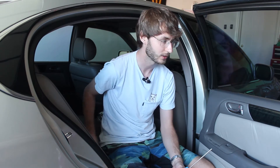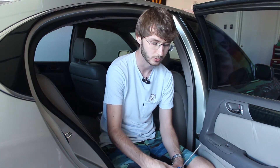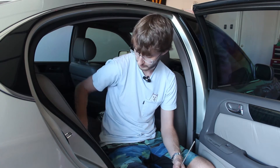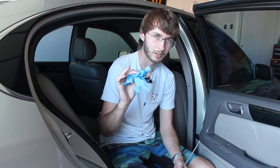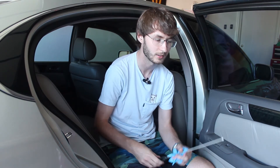In order to do this job you're going to be removing your door panel, so you're going to want to have plastic pry tools. You're also going to want some rubber gloves because everything behind here tends to be really greasy. To remove the screws that hold the door panel on you're going to need a JIS screwdriver, which is different from Phillips — I'll have a link in the description below. So with that we're going to get started on removing the door panel.